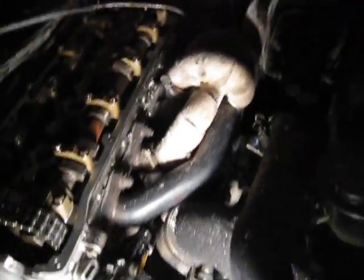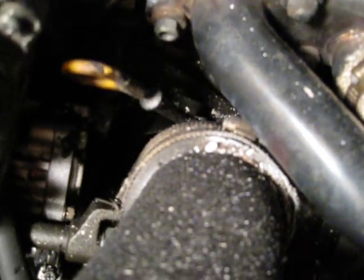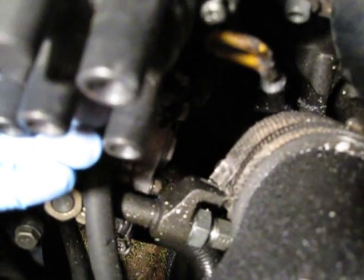Back to what we're going to talk about — if we look at the distributor, you can see this gray piece right here. It's pointing at about the 10 o'clock position. If I put the cap on, this one over here is number one. When you put on the distributor and the bolt matches up, you can see number one hits about right here, and I made a white mark right here for it.